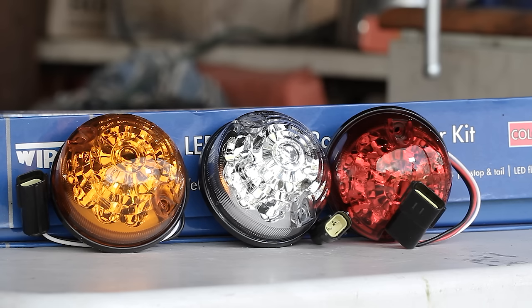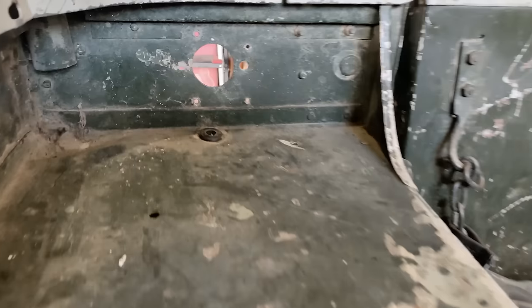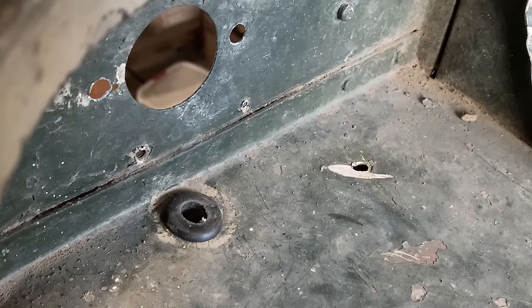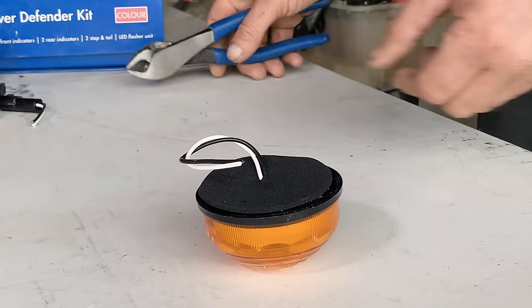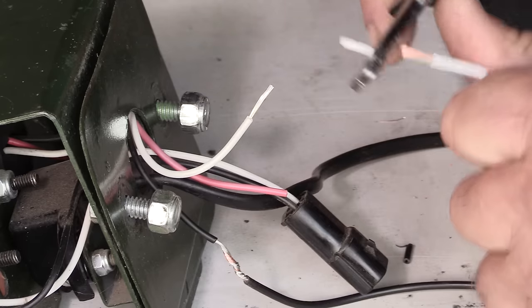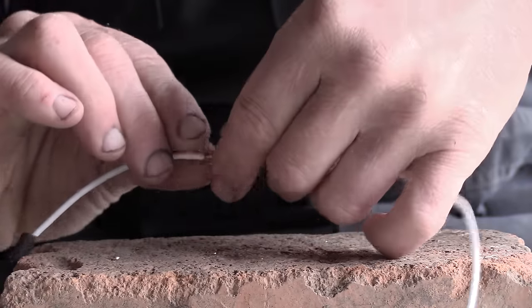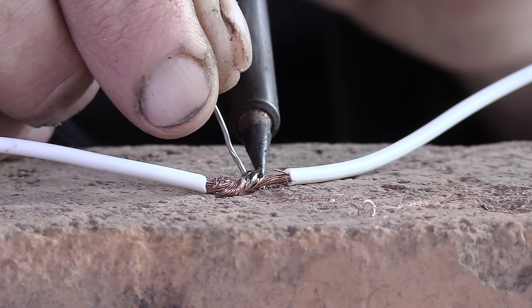Our shiny new running lights come pre-wired with Defender Econoseal connectors, which will not fit either down or up our little grommeted hole that accesses the nether regions beneath the tub. So they're going to have to go. Our plan is to extend our reach, so once we're prepared, the additional lengths can be spliced into our lights and soldered to ensure a somewhat more reliable connection.